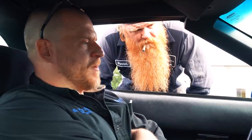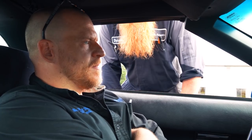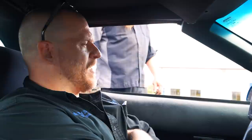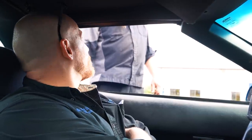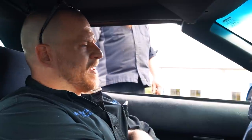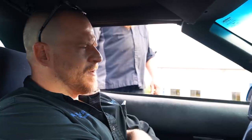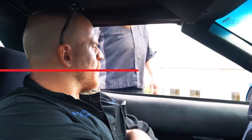That'd be worth maybe looking at again. But the right side is definitely running richer than it should. I'm gonna tell him to drive it. Do an oil change on it if he hasn't recently. Yeah, and then drive it and go from there. I'm not gonna go around in circles looking for this. I checked the basics, PCV, fuel pressure regulator.